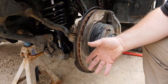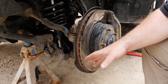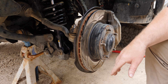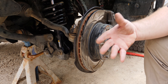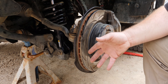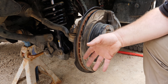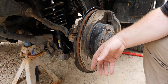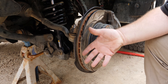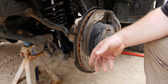A couple of quick words about how we're set up. We've got a jack stand there, it's also on a jack at the back, but never rely on just a jack. We've put the spare tyre underneath the vehicle as well - you need a bit of redundancy. We've also put it in low range and locked the centre differential. If you don't understand why, check the link above - you can actually push a full-time four-wheel drive like the 200 series off a jack if you don't lock the centre diff. So any time you jack up a 200 series or any full-time four-wheel drive, make sure you lock the centre differential.